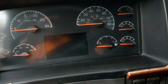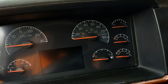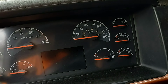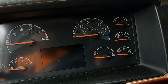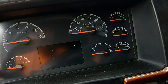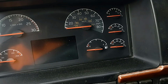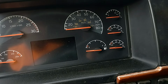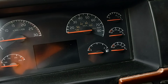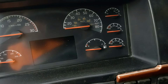Alright guys, so what I was talking about the air pressure there, on my old truck I had a line rigged up. I think it was in the rear tank. When you air the rear tank up, it airs both tanks up. And I think the rear tank has all the suspension stuff in it. And the front one maybe works the brakes, I suppose. There's a check valve in there, I know that much. That way, if you blow an airbag or something out, you don't lose all your brakes, is the way these are rigged up, I suppose. So anyway, if you have to hook air and backfeed it like that, it's probably just going to air up the front tanks. There's actually three tanks on there, and I'm not exactly sure how they are plumbed, but I think that's the gist of it.